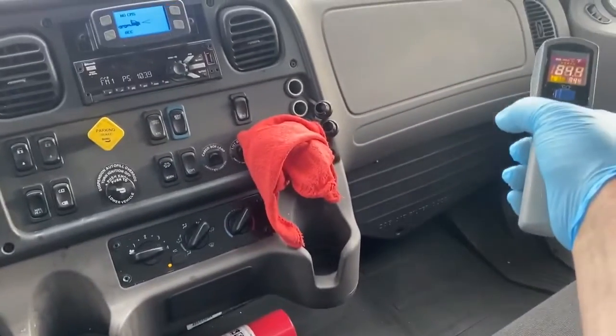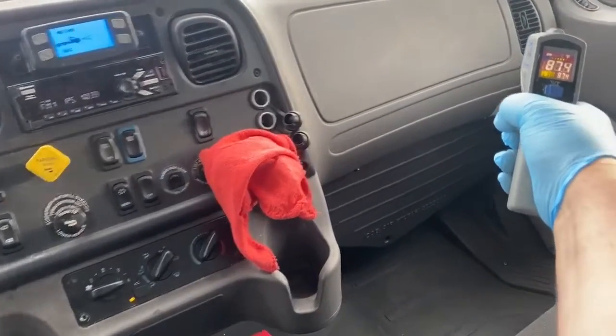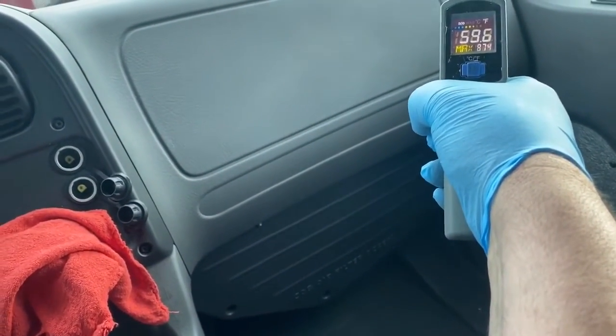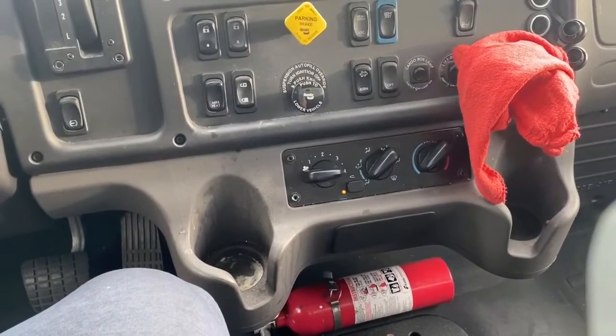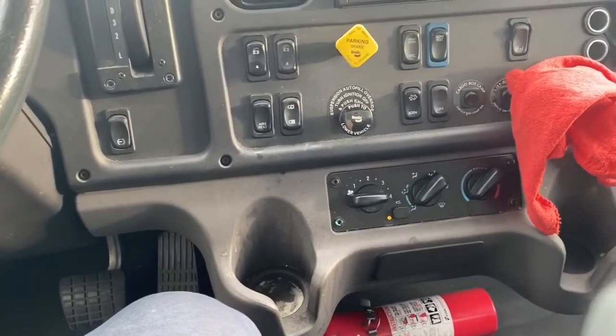You're supposed to check your temperature at the vent closest to the evaporator. So we're going to get right here — so it's coming out of there at 59 degrees. It depends on the temperature outside; you've got to get your spec for your vehicle. That kind of tells you what's coming out of the vent. So now we're going to go outside and talk about stuff to check outside of the vehicle.